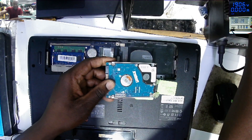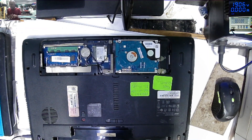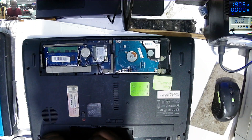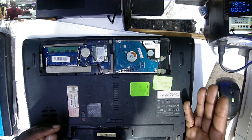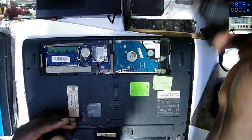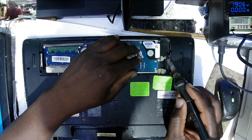Crazy — I don't even want to see this laptop. Why is it so simple today? If you have this kind of laptop that keeps restarting, probably the owner left it unused for a long time. Usually it happens when you leave your laptop for weeks or months without using it — it can develop such issues. All you have to do is take out the BIOS battery, reset the BIOS, and the laptop is working.